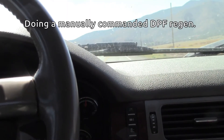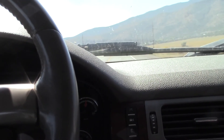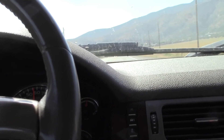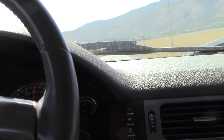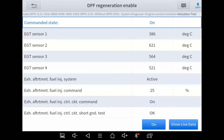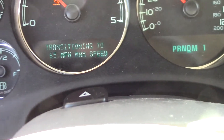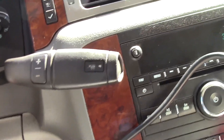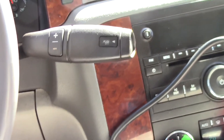Fourth time. We've gone through like a quarter tank already. All right, we're driving now and we're getting some better exhaust temperatures — up to 621°C. Before, when we were doing the 1,900 RPM thing just sitting there, we were only getting like 350°C, occasionally going up to 390°C. Now we're hitting 630°C, so I think it's doing a good job doing the regen now. We'll see if this will complete a regen and then try the reductant fluid test again. We've successfully run the DPF regen and got temperatures between 600 and 725°C, which should have cleaned up the DPF nicely.